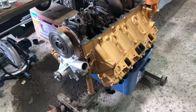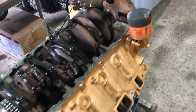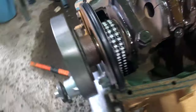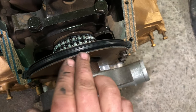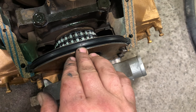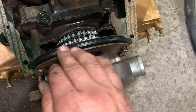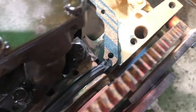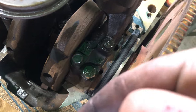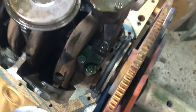We got her flipped over, surfaces all cleaned, all dried, all ready. When you install your front main seal, put a little dab of assembly lube on the nipple - there's a nipple in the center that goes into a small hole. Start by installing that center first with a little bit of lube so it slides in nice and easy, then work your way back both sides. Skimmed with a little RTV just to hold that gasket in place. The rear seal sits up over top of the cork - make sure it's not pushed to one side and that it's flush.